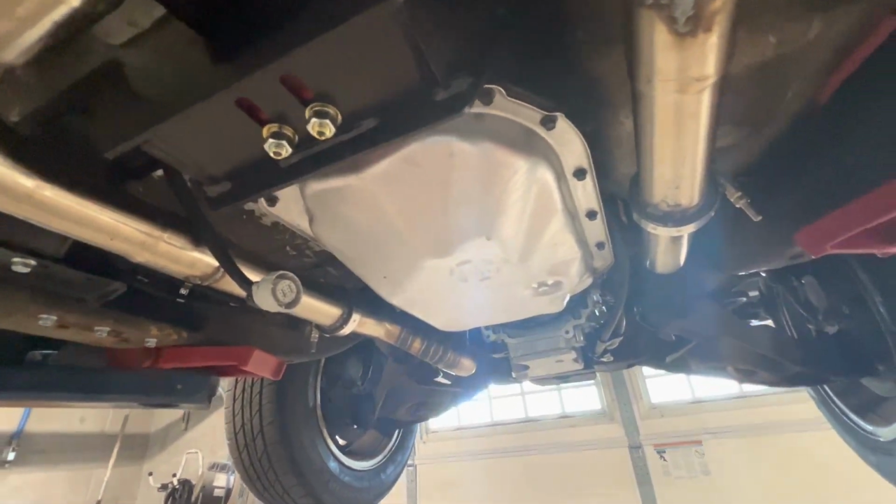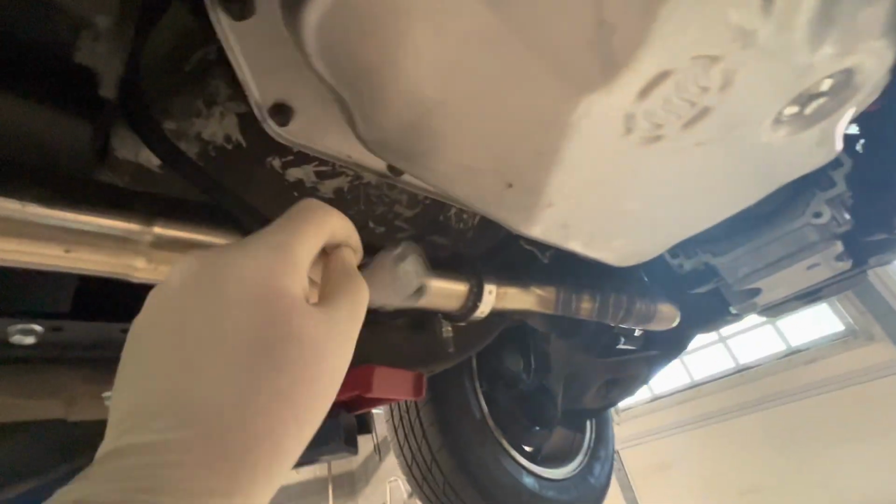So I've pretty much deemed it's definitely the transmission. It's nothing in the tune. So I've started removing it. Already disconnected a couple things. Got the torque converter loose. So also found I have to fix the starter wire. That ripped off way too easy. I didn't have it clamped on good enough.